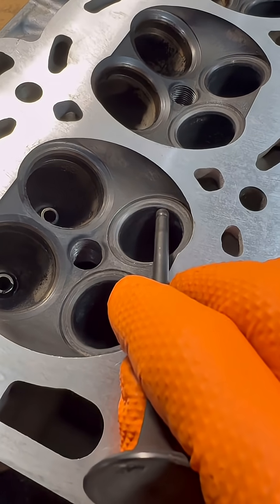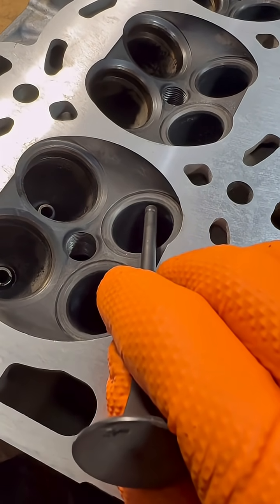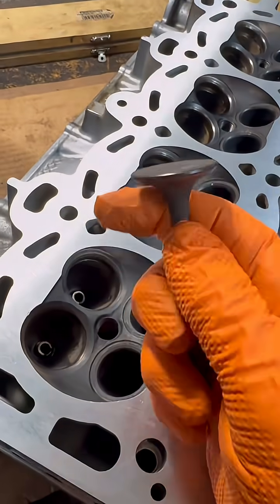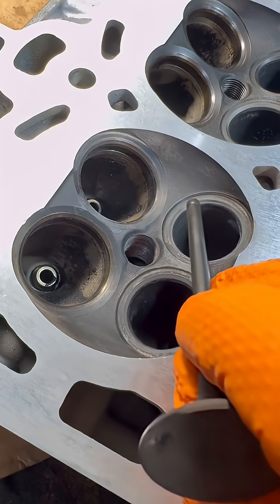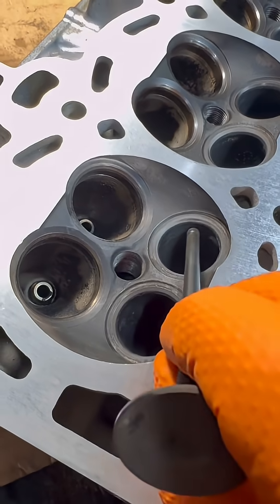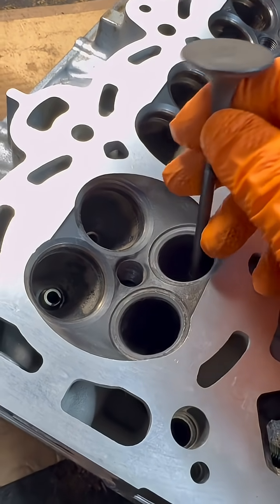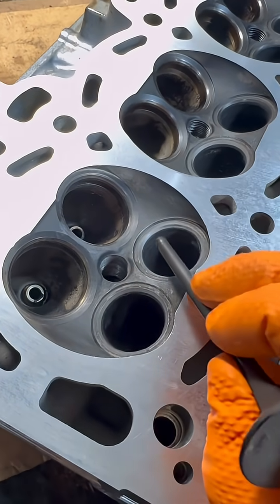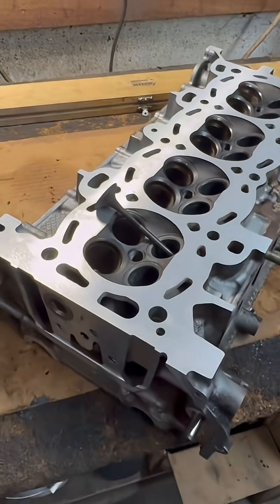If it's not touching, it's going to leak, cause a misfire, and eventually the hot gases are going to cut into the valve like a torch. This is a step that could be avoided — either get new valves, do them a little better, or you may have to replace the seat. Just keep an eye on that when you're doing the valve lapping.